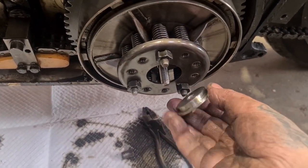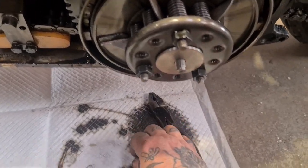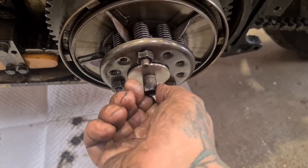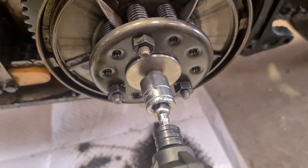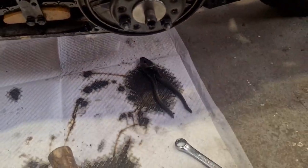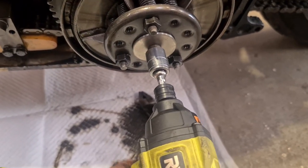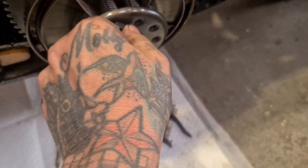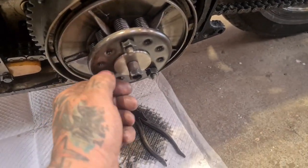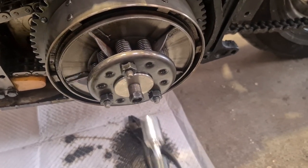Here's the part — that goes over the adjuster screw and then catches the pressure plate, and we can put the adjuster nut on. Then we can spin it up a bit — excuse me while I do it with my hand, if I get the right socket. So we can knock this in a little bit and that will compress the springs, and then we can take these adjuster nuts off and remove the clutch without upsetting how it's set up. So it's a clutch spring compression tool — job's a good one.